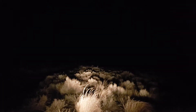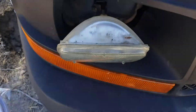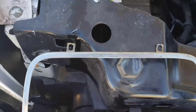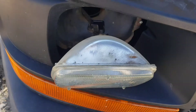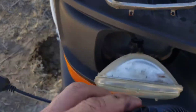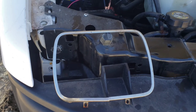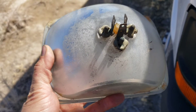We're swapping in new LED headlights. Basically you've got a metal retaining ring, two screws on the top, two screws on the bottom, and then there's just your light plug-in on the back. Put the new metal retaining ring around it, plug that in, put those four screws back — that should be it. Here's the old headlight — it doesn't pass the shake test.